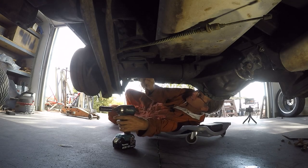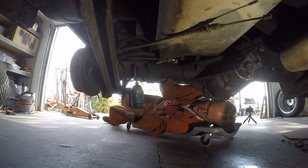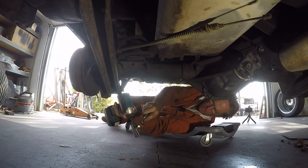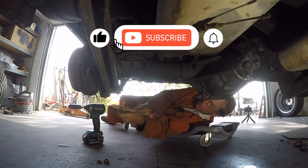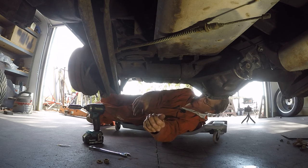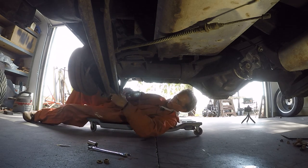We've got some spring clamps on here we're going to have to get off. We've already got the hydraulic brake line off and the emergency brake cable is off. We need to get the shocks loose. I've got the trailing arm nuts all loose. I'm going to get the jack under here before I start knocking bolts out, but I've got them backed off pretty good. So let's get the shocks loose and this thing is about ready to come out.